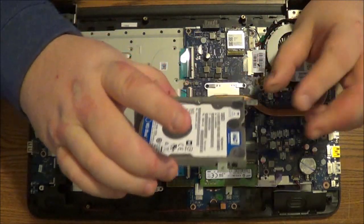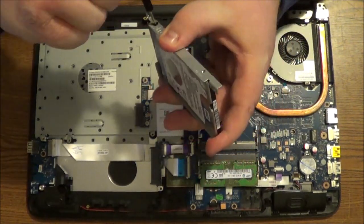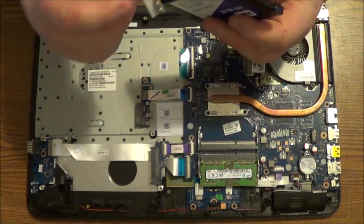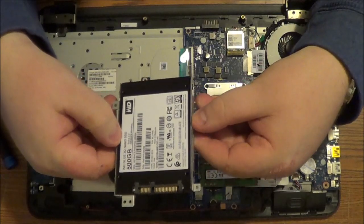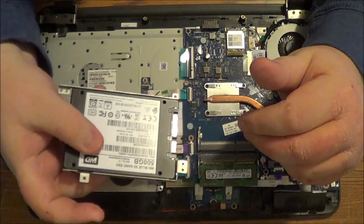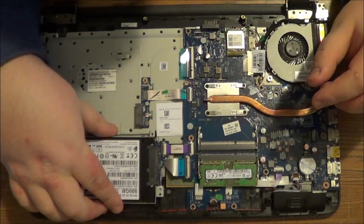Once you have it apart, you do want to take the bracket that's on here off. And now the drive is free. With the new drive, you'll have where it's set — take off the tab and put the tab back onto the board. Once you have the bracket back on, do note that you put the bracket back on the same way that you got it off the other drive, because these are designed to sit upside down. So you want to make sure that you put the brackets in the same orientation as the old drive. Then we can reconnect the drive and just place it right back into its cradle.